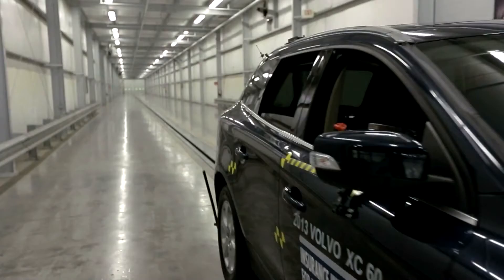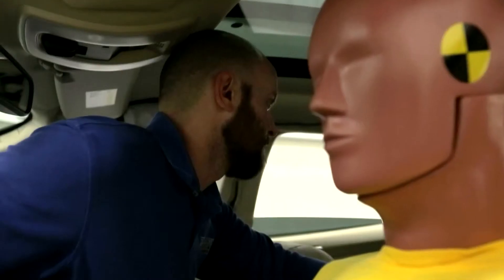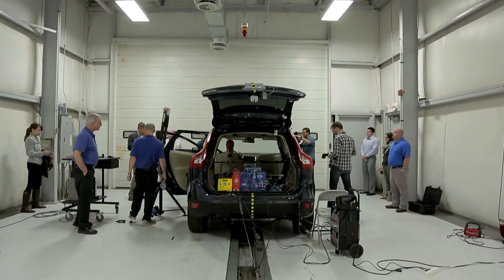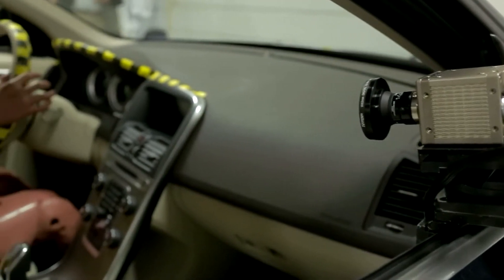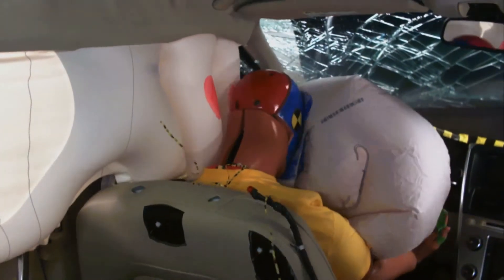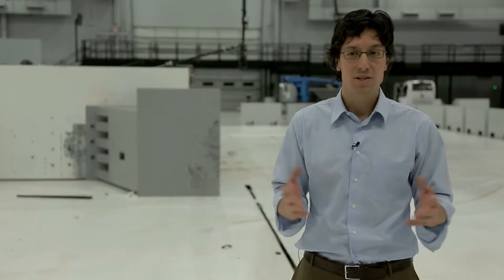Following the crash hall, we move the vehicle back into our shed to let the vehicle and the dummy sit in the temperature-controlled shed right before the crash. When we prep the dummy right before the crash, we place makeup or grease paint on the dummy's head and also on the dummy's knees. We do this so that after the crash, we can document the different head contact locations and have some indication as to where the head loaded the airbag or slid off and hit another vehicle component. After that, we go through some final dummy positioning and then we crash the car.